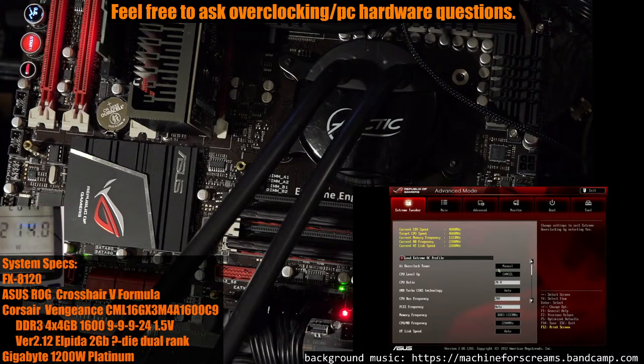I actually like the BIOS on the UD3s. I have a UD3 equivalent. It's the same VRM as a UD3. But it also comes with a postcode. That's the one difference. Because the board I've used for most of my valids was the 990FX Gaming. And the VRM is a problem. It shuts down trying to run Cinebench. It shuts down trying to get into Windows if the chip is thirsty enough.